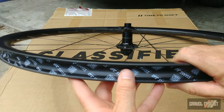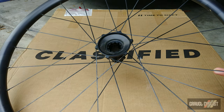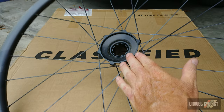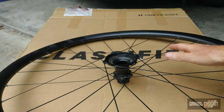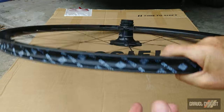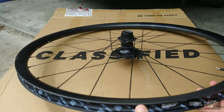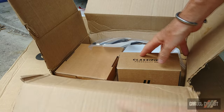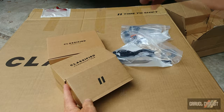Let's grab the rear wheel. The obvious unusual thing about this wheelset is there is no center — no hub body installed yet — so the PowerShift hub can be swapped between this wheelset and any other compatible wheelset. There are 24 spokes again. On the drive side there's a two-cross pattern; on the disc side, also center lock and a two-cross pattern. Same rim and same DT Aerolite straight-pull spokes as the front. Now let's open the interesting box containing the Classified PowerShift hub.